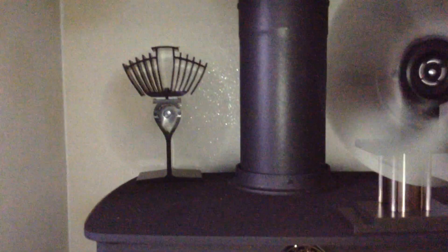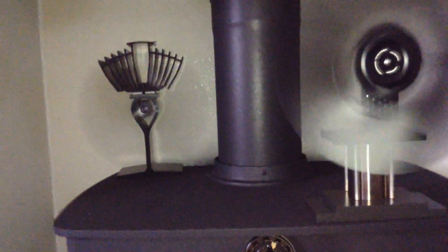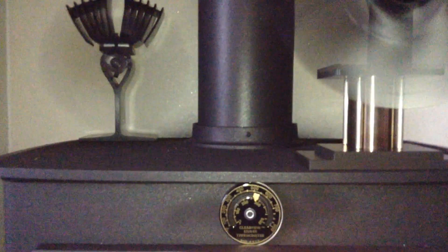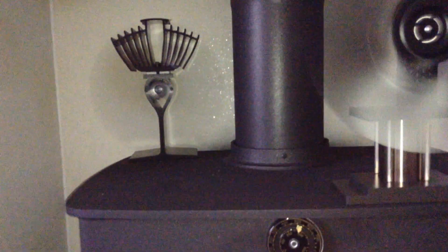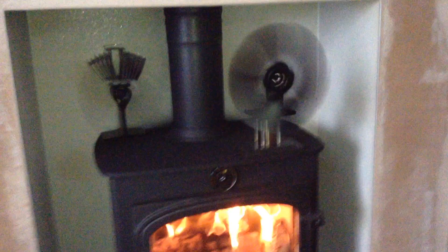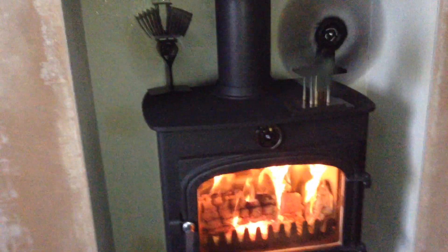The eco fan runs at a very low temperature and maintains its maximum output up to a safe operating temperature. On mine I normally go to about 550°F. At its maximum speed it runs right down to about 150–200°F. But the Vulcan needs at least 300°F before you can start to get it going, and you have to start it manually as well. The eco fan will just carry on going once it hits the temperature.